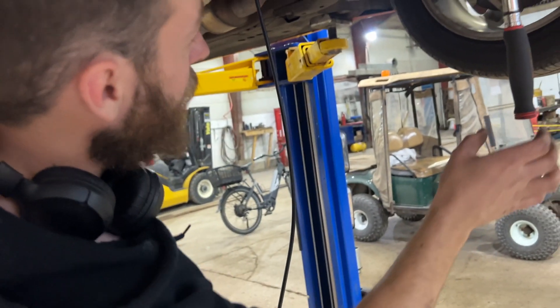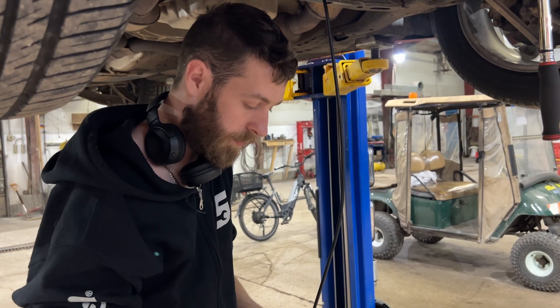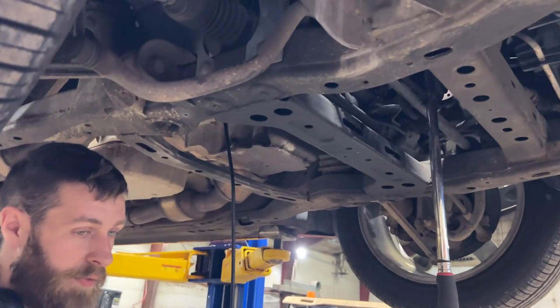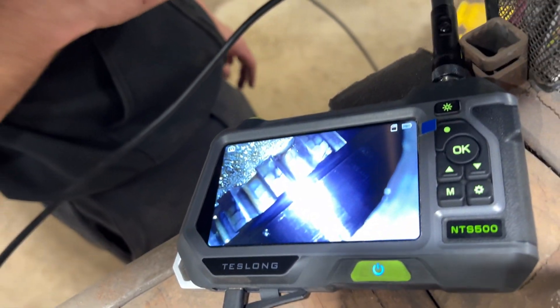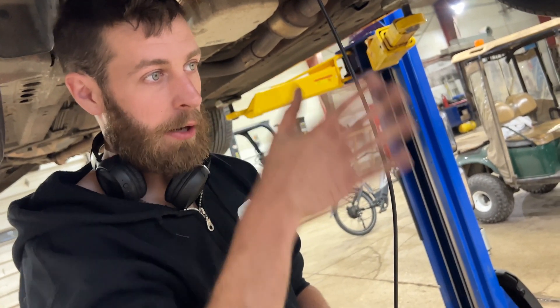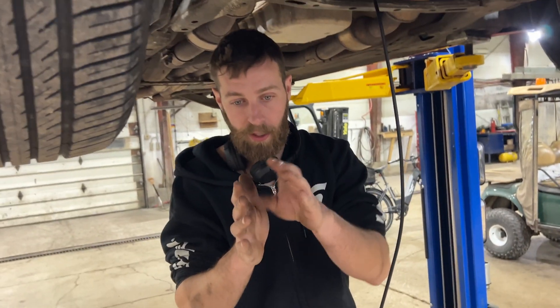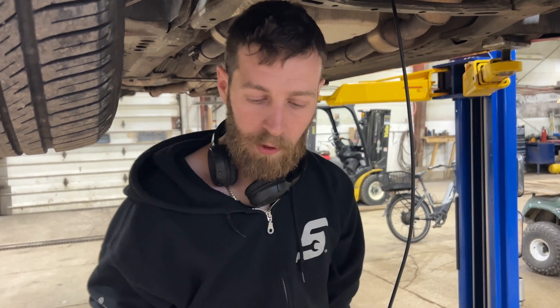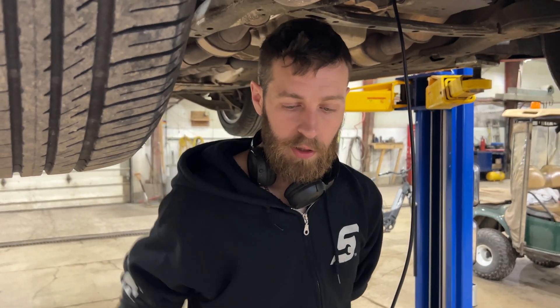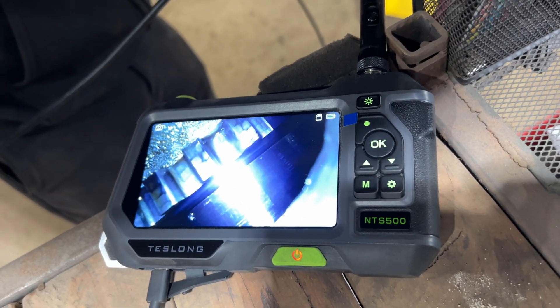One thing I'm going to check when I make the next video, before I pull the engine out, is to take the pan off and see if there's any way to move that tone ring without removing the crankshaft itself. But I'm pretty sure with the counterweight and the way the tone ring sits at the end of the block, there'll be no way to get in there — you wouldn't want to use a punch and a hammer because you'd probably just mangle one of the teeth off. So that's how you check it. If you have a better way, let me know in the comments. Thanks for watching — stay tuned for the next video where I'll show you how we're going to fix this.